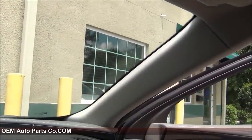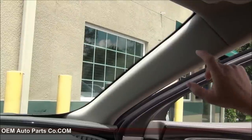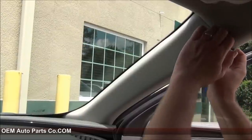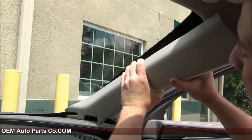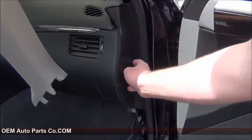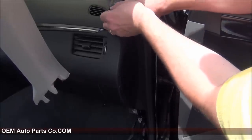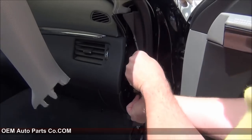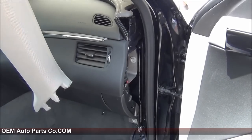Now what we're going to want to do is install the GPS antenna. To do that, we're going to remove this right A-pillar windshield panel. You could use a trim stick or just your hands — it's just held in with retaining clips, so pop it out and slide it out. Now on the right side of the dash here there's a little trim plate. We're going to want to pop this out. Once again, another trim plate that's just held in with retaining clips.